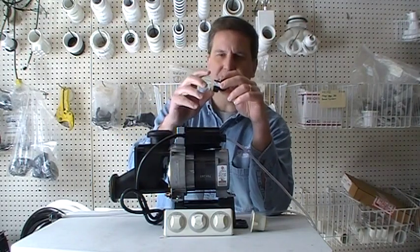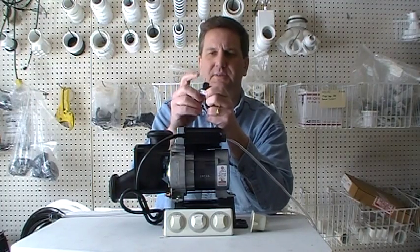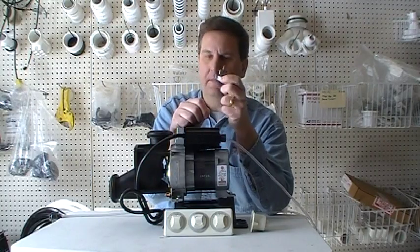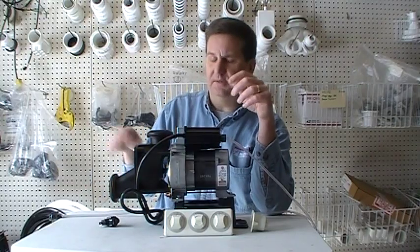The air switch has a lock nut on the back side. Once you take the top housing off, you can remove it from the lock nut. It's a simple two-wire connection — all you're doing is sliding the two wires off those two terminals and putting them back on. It's very simple to change.